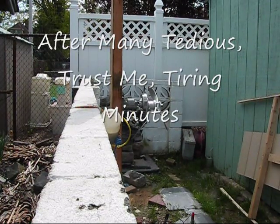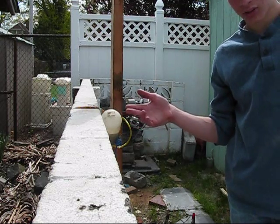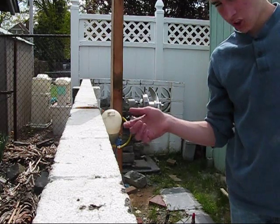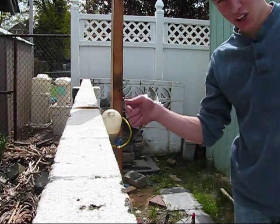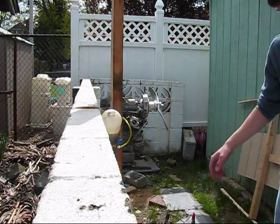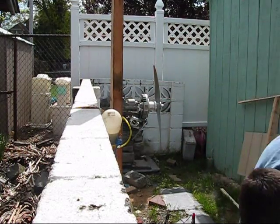I think I figured out the problem. It's because I'm using a glow fuel tank and the rubber inside isn't meant for gas, so it's all falling apart inside. The hose came off. I think I'm putting it by the clunk but I'm not because the hose fell off, so I tilted the tank forward — let's see if I can get it started.